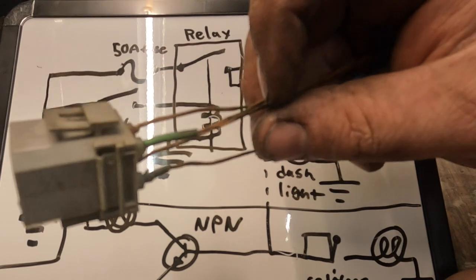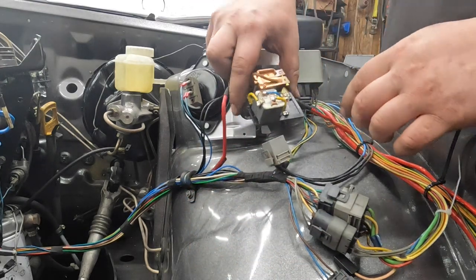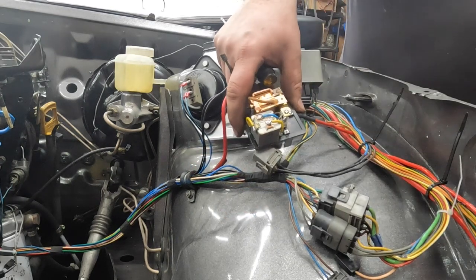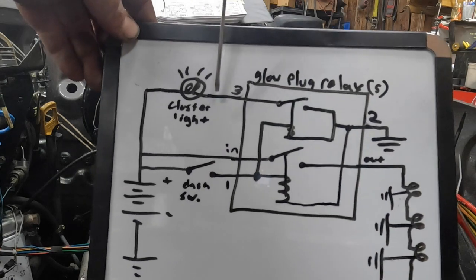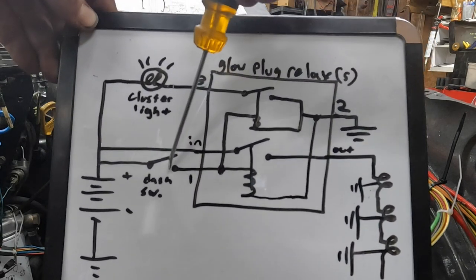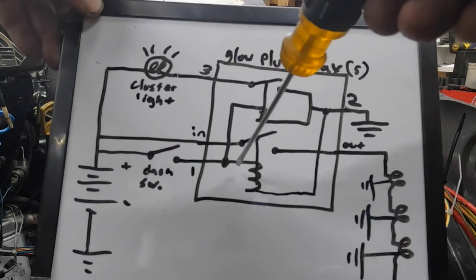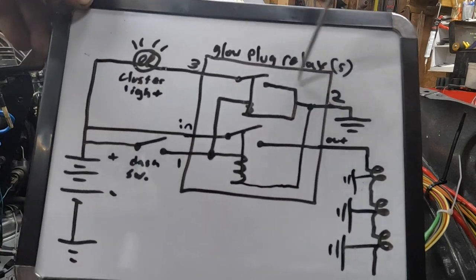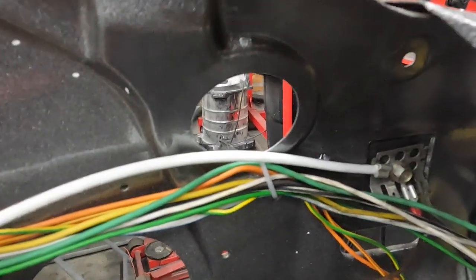I made some changes mainly because I found a little relay before I found a transistor in the old parts bin — I think that's a horn relay from a Mark II Jetta, but it fits in the glow plug relay box quite nicely. The light in the cluster did end up being a switched ground — I could tell just by looking at the flex circuit in the back of the cluster. There's the switch on the dash, here's the actual relay for the glow plugs, and here's that other little relay. When we power that control coil we also power this one, which shoves the electrons from the light through onto ground, which is run down to the grounding block in the front apron — quite convenient.